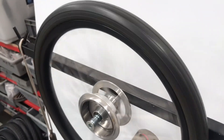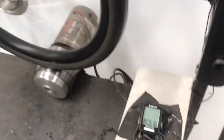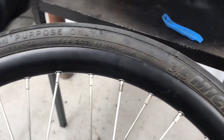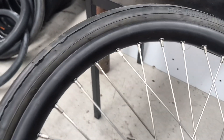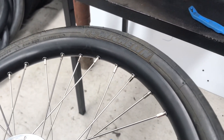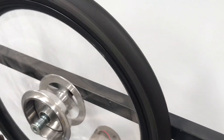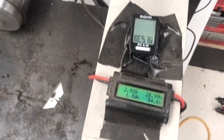The Michelin Eco Racer Radial at 26 degrees registered 47 watts. I had about four attempts trying to get this tyre to run straight on the bead, and as you saw it was running pretty rough — but it didn't seem to affect the drag. You can probably take it that the number I'm reporting today is the worst number for this tyre, not the best. Pretty amazing tyre; not sure if it's still available. It achieves this number by having basically no rubber on the running surface, so it's pretty sketchy for anything other than an absolute speed run. The Schwalbe Kojak 20-inch at 27 degrees registered 84 watts.